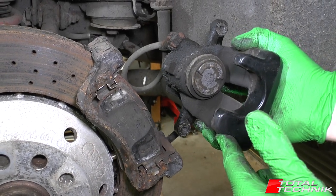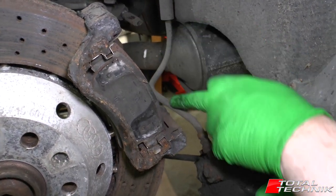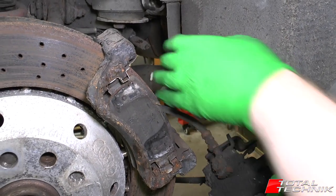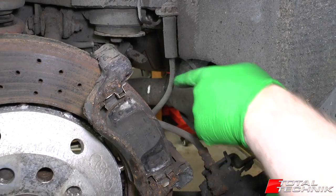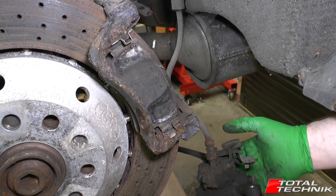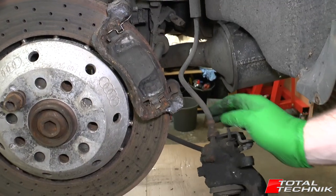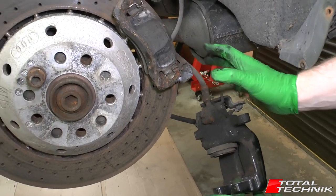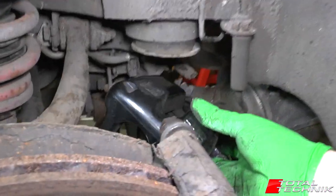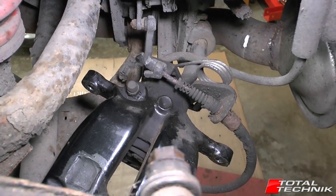That's the caliper removed. What you don't want to do is just let the caliper hang down, because you've got the flexi hose here which is connected to the brake system — this is what brings the brake fluid into the caliper. You can put a strain on it if the caliper hangs from the brake cable. For the rears you also have the handbrake cable, so the tension is actually on the handbrake cable rather than the flexi line. Front calipers are heavier and chunkier, so find somewhere on top of the suspension components to just sit it safely in situ.